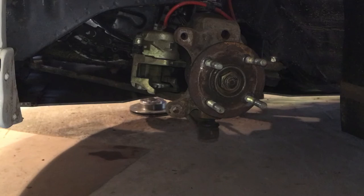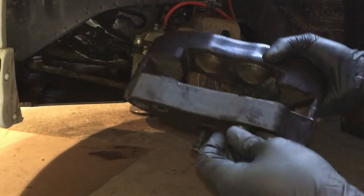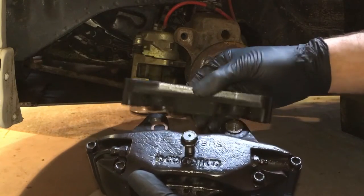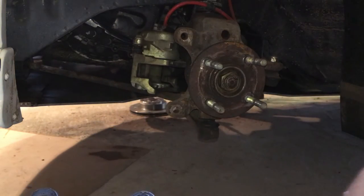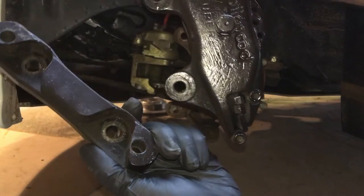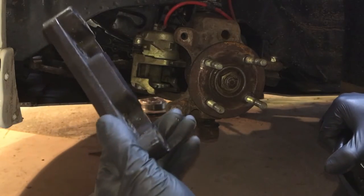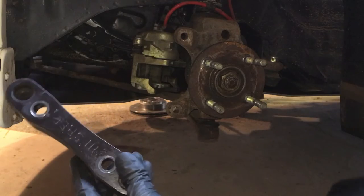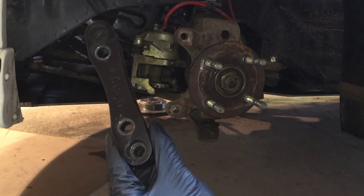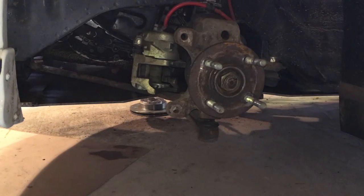I'll do a time-lapse of putting it together, but first let me show you this. I'm taking the bolts out so you can see it — there are two washers and that's all it is. It bolts on pretty simply. You might still be able to get these calipers from Wilwood. For the caliper bolts, use high-ten steel bolts only — no normal stainless, we don't want those breaking.